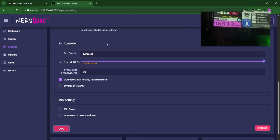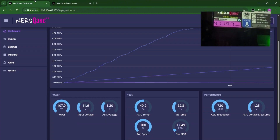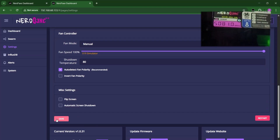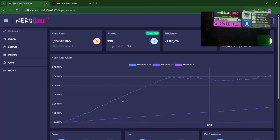Now it's at 62.1. Let's lower the core voltage to 1200 — don't push it that much. That way it's going to stay around 61 to 62 degrees. So we added a fan in front of the VR. We are now at 55.4 degrees VR temp. So maybe 1270 core voltage and see for yourself. I don't want to push this drastically — let's just try to increase it a little bit every time. Right now we are hashing at 5,198.